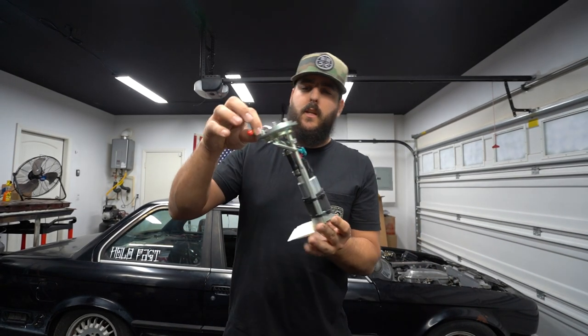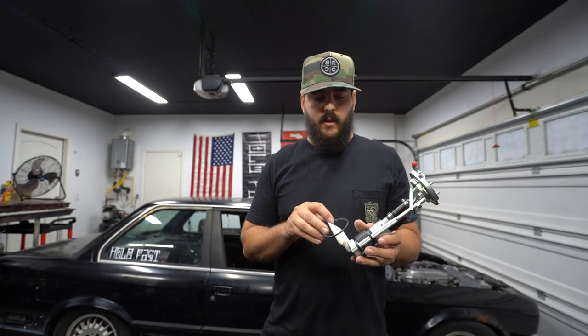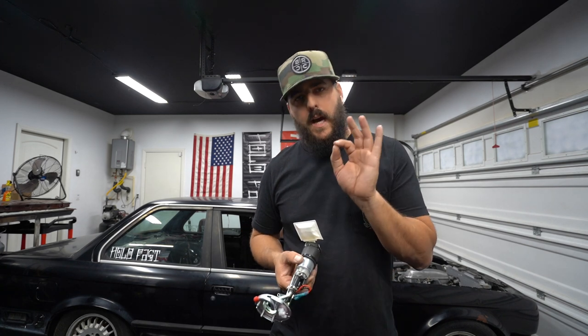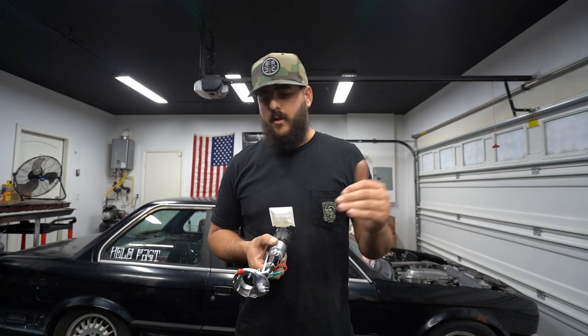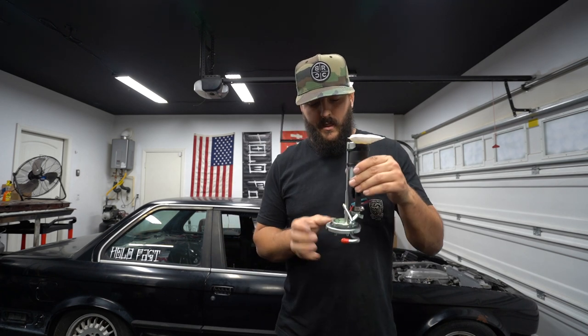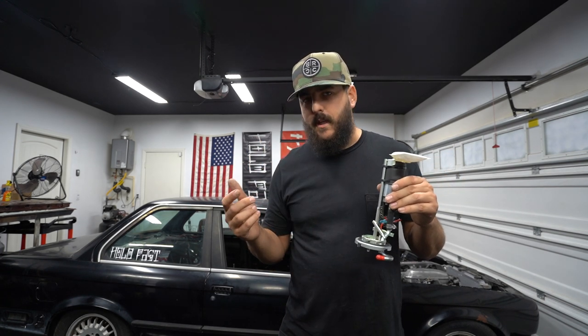Now that the pump is set up on the E30 hanger, it's time to throw it into the car. You're going to need the O-ring that it comes with, or a new O-ring, or if you have to, you can utilize your old one. I used what I had around to get me to where I needed to go, because sometimes in life that's just the position you're in. In this case I have the ability to get a new one, and new ones came with the products I ordered, so I got lucky. If you have to use your old one, I don't want to shame you about it — as long as it's still kind of soft, you're good. If it's hard plastic, brittle, and breaking, it's junk — swap it. O-rings aren't that expensive.